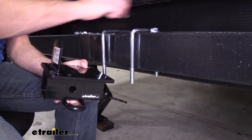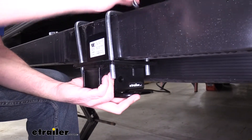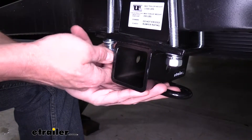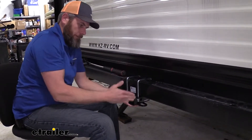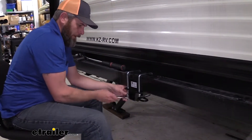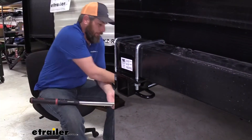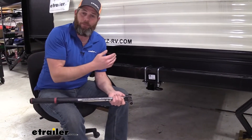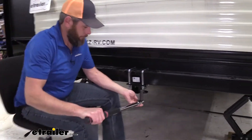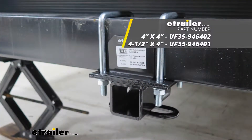Get our hardware ready, slide it right up and on. At each spot, we want to put on a flat washer, a lock washer, and our nut. Select the position we want, make sure our U-bolts are running up and down, then snug up the nuts. You'll want to use a 19mm or three quarter inch wrench. With those snugged up, it's time to get our bolts torqued down to the specifications listed in the instructions — the two on the rear first, then the two in the front. And that's going to complete our look at the UltraFab bumper mount RV hitches.